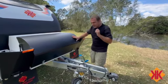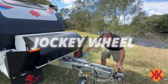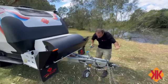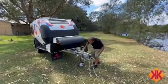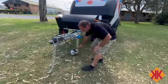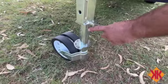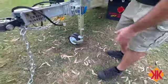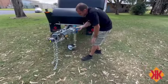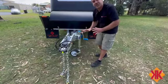The last item when hooking up to the vehicle is the jockey wheel. This is quite a high off-road unit, so I'm winding it up to get it off the vehicle. As I get that off, I end up with it really high. I've got an indicator right here showing my max height - please do not push, pull, drag, or skull-drag anything above that max height as that is a weak point. I can go straight up to get it off, then lower it down below that line to make sure it's not too long and won't damage the jockey wheel.